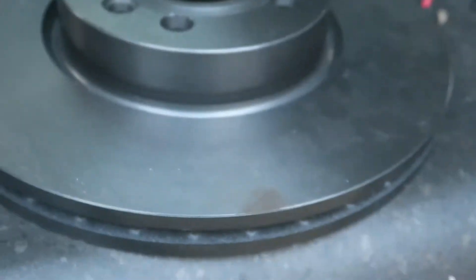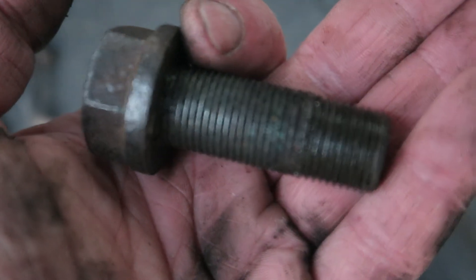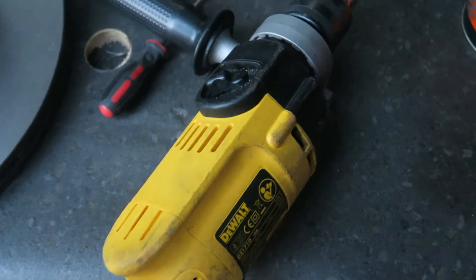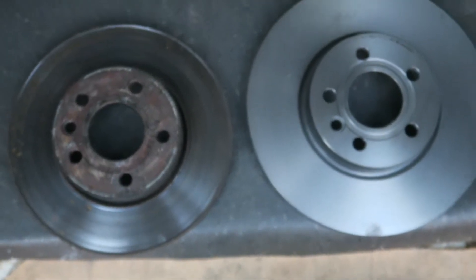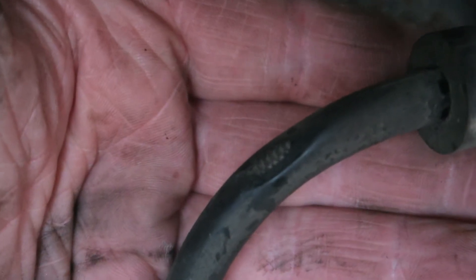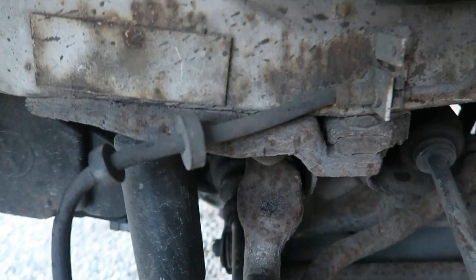I've got the solid one off now — that's the new one. You can really see the size difference; it's vented, and the caliper's much beefier as well. Now I've got to drill out an 18mm hole — got the 18mm reduced shank drill bit to make way for the bigger bolts. I've also noticed the hoses here are pretty knackered; we've got some wear on the brake line where it's been rubbing on the tyre, and also quite a bit of wear at the top of the flexi. So I'm going to cut that off, stick a bolt in it, and get some new goodridge lines for this.